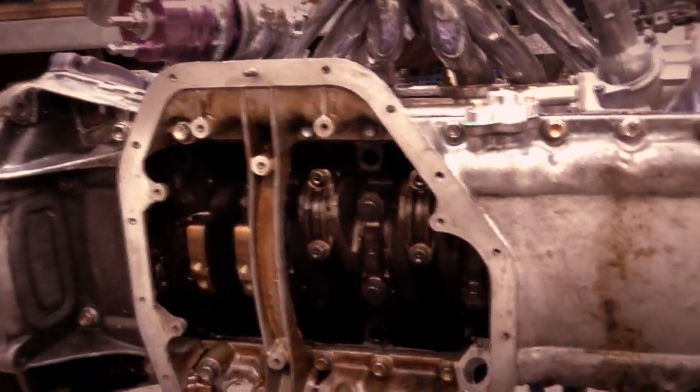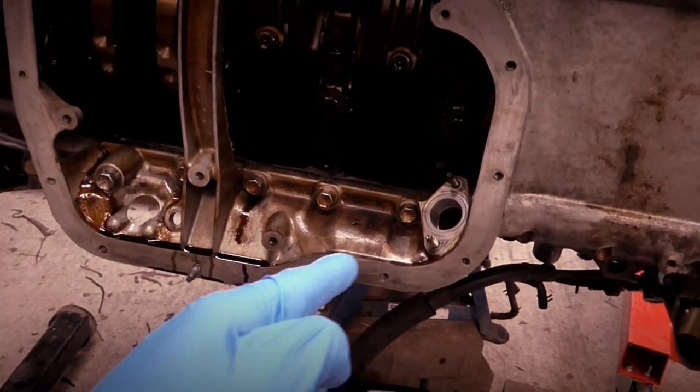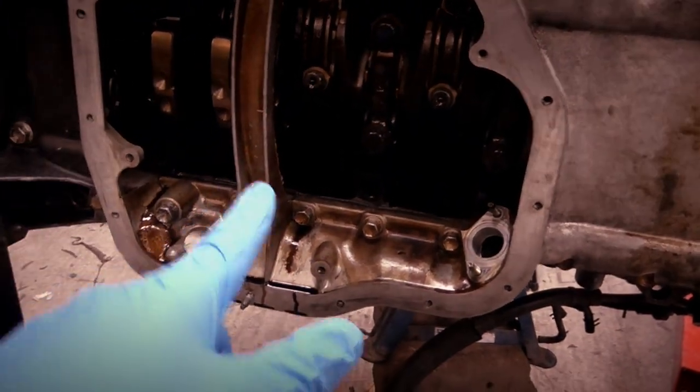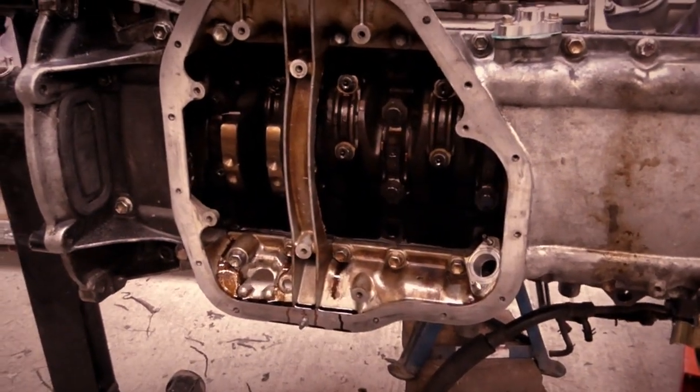And we're currently at this situation. I need to put the gasket for the strainer. I need to put the baffle plate that was in, and then the strainer. Clean up the last bit of oil around there. Clean up the bottom sump, and then attach the bottom sump. Then it's done, and I can actually put the bolts back in the frame as well now.